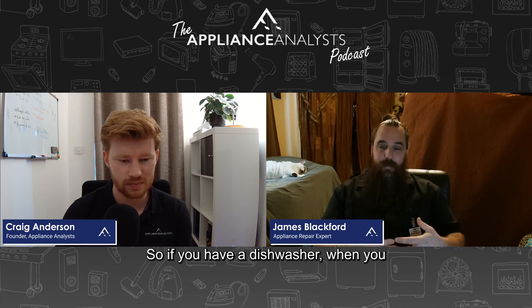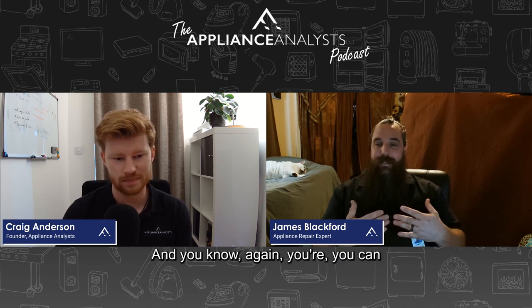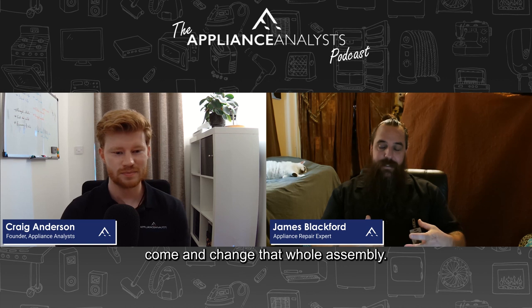So if you have a dishwasher, when you open the door and look inside, if you cannot see a heating element, it's one of the dishwashers where it's incorporated. And again, you can still check it. But if it's bad, then you may want to call somebody to come and change that whole assembly.